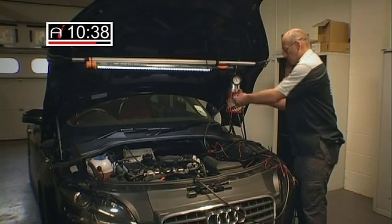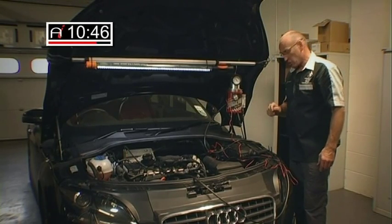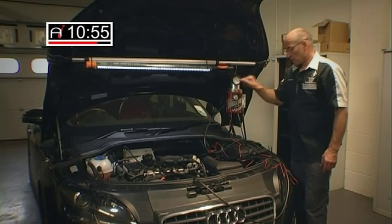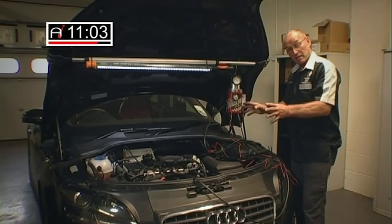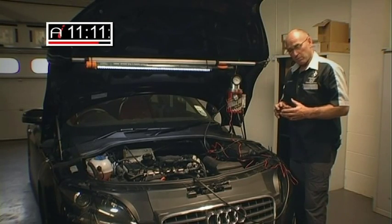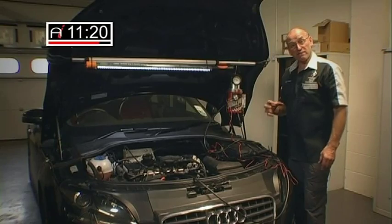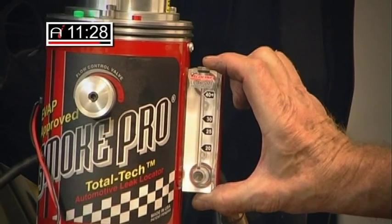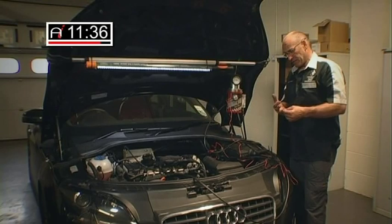Going back to the application of the tool — I've turned that off because we've found a leak, so we need to resolve that. Now, EGR valves. Quite often, an EGR valve that has a subtle fault, whereby it's passing gases when it shouldn't when it's closed, often results in no pressure drop. Whereas the manometer often detects that there is flow from the circuit. What happens is you pressurize the intake system, but if the EGR is partially open, it diverts itself straight into the exhaust system. The value of the manometer is in detecting very subtle internal leaks with enclosed crankcase breather systems and EGR circuits.